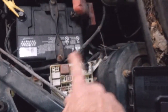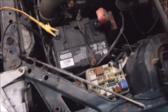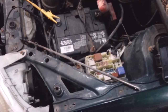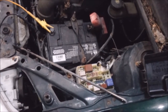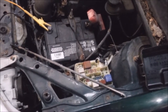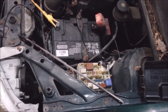That's how you find a parasitic draw. You just want to start pulling fuses one by one until you see that amperage drop. And then when it does, you know you've isolated your circuit, and that gets you started. After you isolate your circuit, you can go from there and see what's going on in the car. I didn't have to fix the wiring problem — it might have a short to ground somewhere, or there might be a problem with the horn. But that's how you find it anyways.